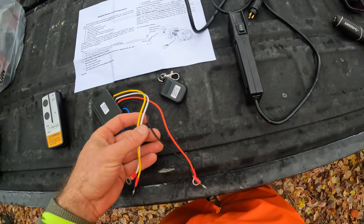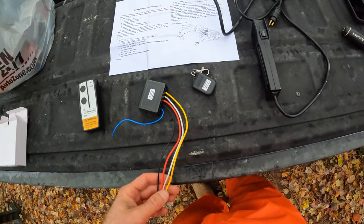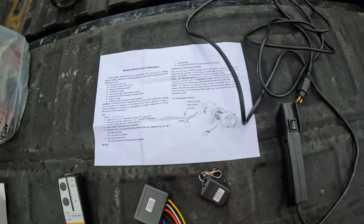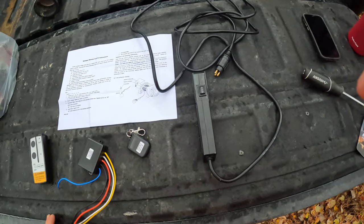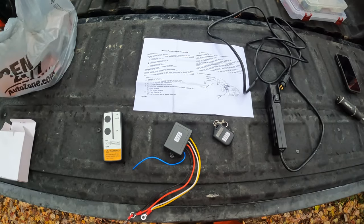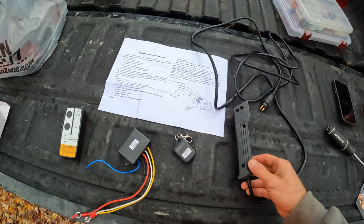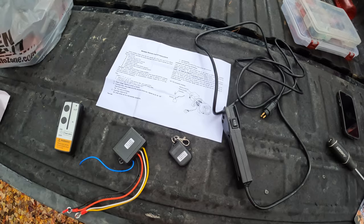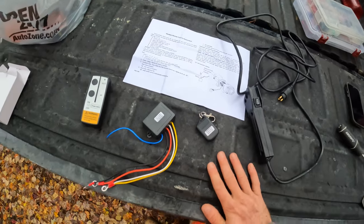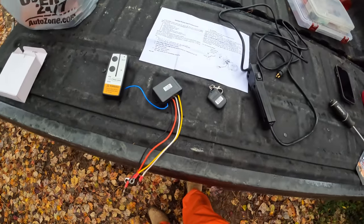Something like this can seem pretty intimidating when you're just looking at the ad on Amazon. It just shows you a couple wires and there's really no other instructions. It's got a very crude diagram with a winch kind of telling you what to do. In my application it's going to be slightly different — we're not really going to be able to tell until we really get into it. My idea is I have a voltmeter in my truck; I'm going to disassemble this remote and get just the three wires out of it, do a little testing to see what it's actually doing when it's plugged in, and that will give me a good idea of how to make it all pair up.